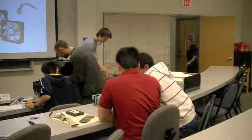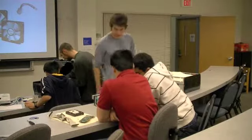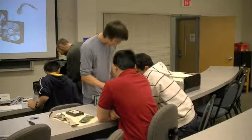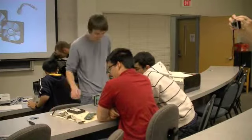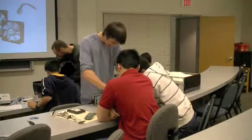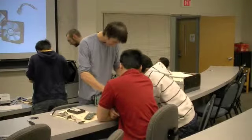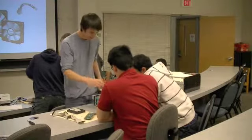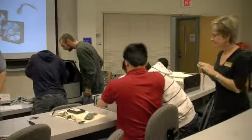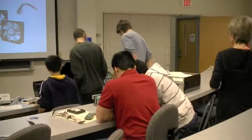That comes down to the socket. CPU, okay, this one is really tricky. A certain socket, and you buy the motherboard to match that socket. It uses two heat sink clamps. So these are the clamps. These will go across and down. So then you'll be locked in. See, it's a jam. So go ahead and try that again. Processor wise, and then if you want to plug this in, fan. We'll do the fan next. Can you get those both in?